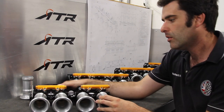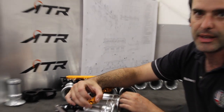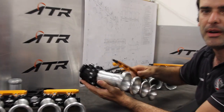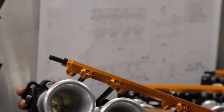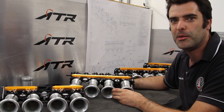The fuel rail also has an M10 by 1mm fitting on the end. The standard comes with just an 8mm pipe fitting. We also have the option to fit various dash fittings if you choose to run braided hose. That covers the basic features we've incorporated into the throttle bodies — I hope you enjoy the video.